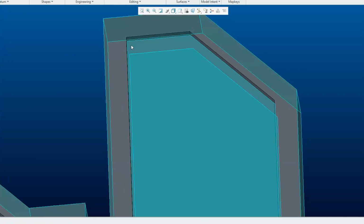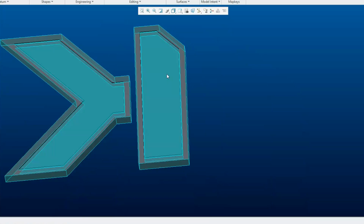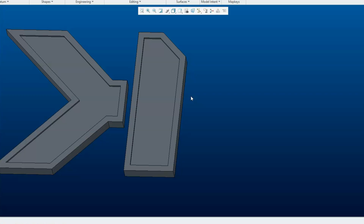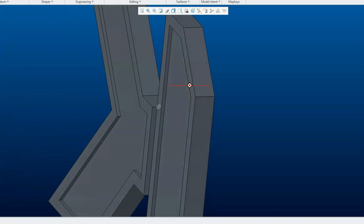And lastly, on the bottom side, I did the same thing. It's only 30 thousandths high on the bottom. The reason I did that is so that I could put the double-sided tape inside here to attach to the car, since the double-sided tape has some thickness to it because it has that foam base. So that's why I brought down the edges so that it covers up the side of the foam, and it would really just give it that seamless look.